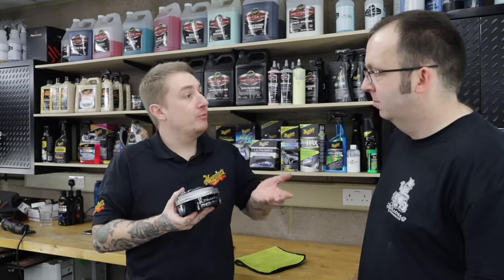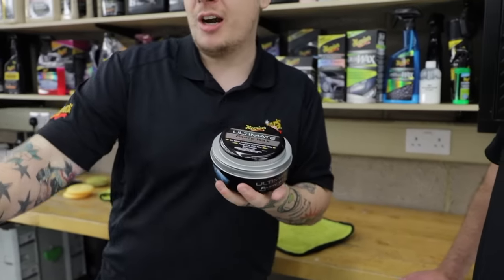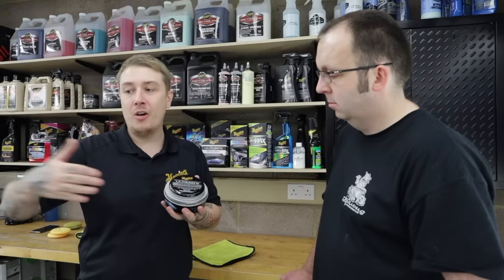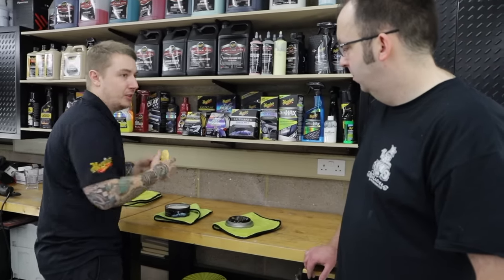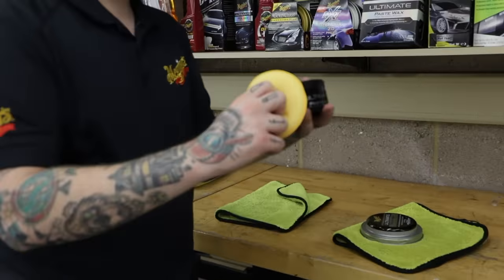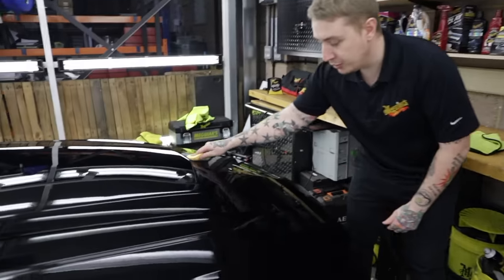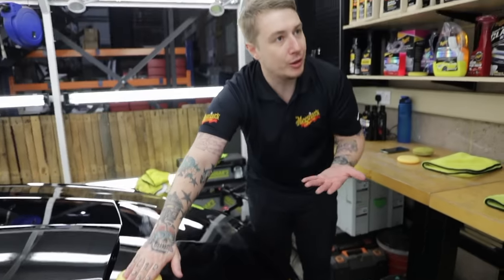We've done the hard work of reviving the paint with the compound and then refining that with the glossy ultimate polish oils. Now we want to protect that, because none of those processes will protect the paint - they'll enhance and refine it, but we want to put that layer of protection on there, especially through the winter months, to maintain that gloss. With that we're going to use our ultimate wax. I love using this on dark cars because it's fully synthetic, which means it hazes till clear and gives darker colours that real wet look. Being fully synthetic also means longer-lasting protection, and it's super soft to remove using less product. To apply the wax, we do it by hand - less is more. Pinch the top of your pad, put it on the wax, half a turn - that's going to confidently do that whole half of the bonnet. Per section, draw some lines over it and then gently do one pass over those lines to top up the pad and ensure even coverage of wax on the surface.